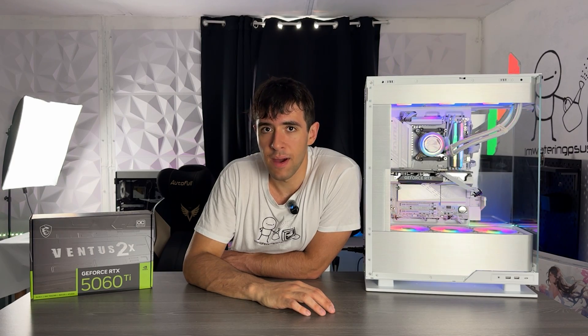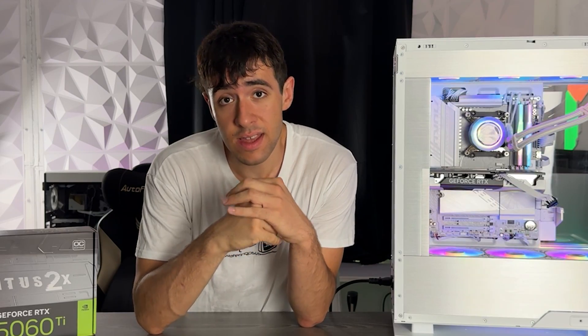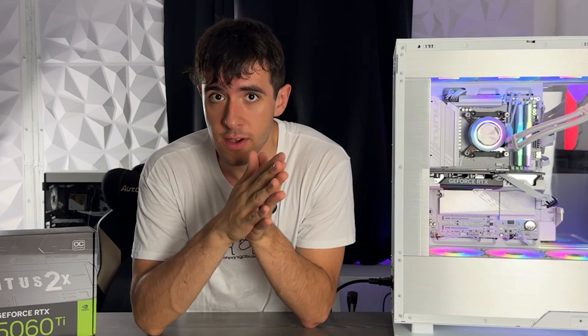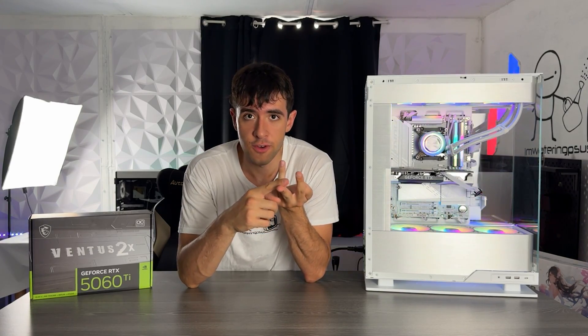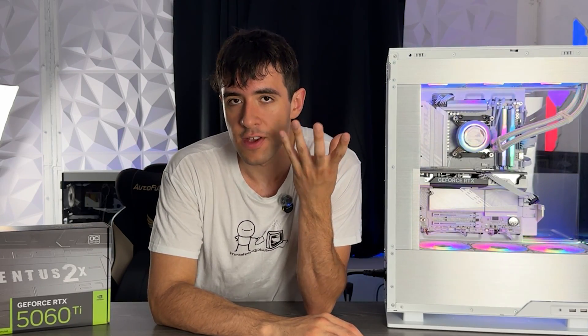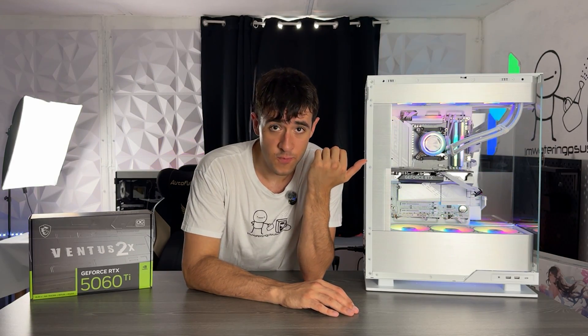If you need to buy one because it's cheap, or you're watching this in the future and find one secondhand, yes you can buy it — it doesn't have any big issues; just make sure the fan is working without noise. But if you have another choice, especially buying brand new, I would buy something else. My main advice if you do buy this card is to undervolt it — it's what we do on the channel, I have a tutorial for it, and it works for every GPU, giving you more performance and lower temperatures. That said, it's not right that we have to undervolt a card to make it run quietly and fix the coil whine — it should be fixed out of the box.